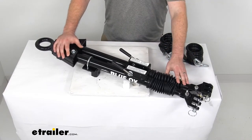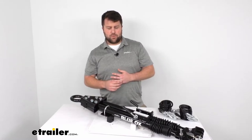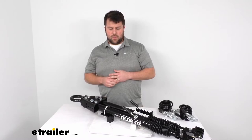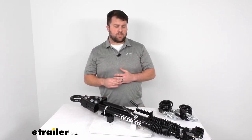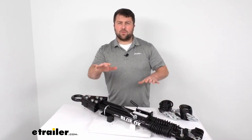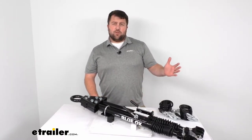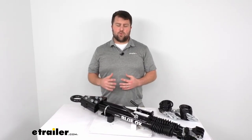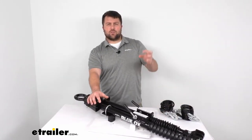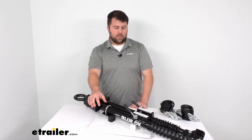This is a self-aligning tow bar, which means you can pull your tow vehicle up close to your RV without needing to be in the exact right position, because the arms expand out a little bit to compensate if you're slightly off. Once you have everything hooked up, you can start driving forward — the arms are going to lock out as you go, creating that nice solid connection.